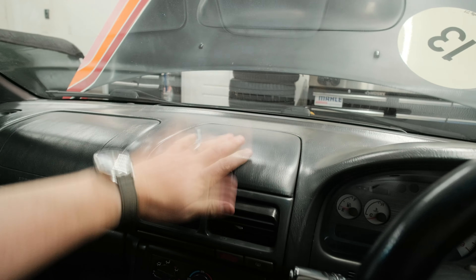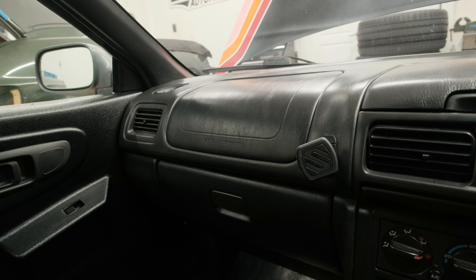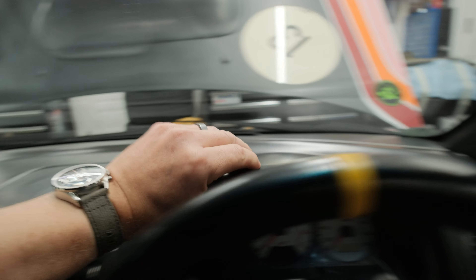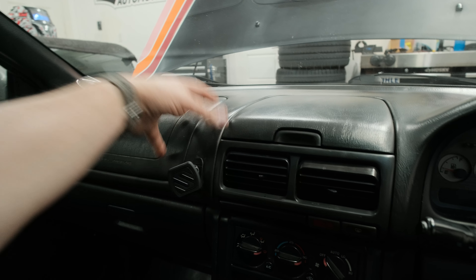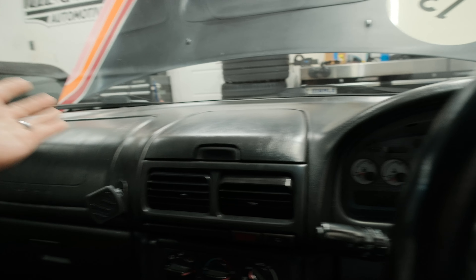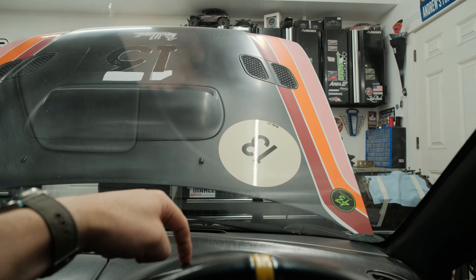One thing that I bought for the original build of the car to go on the first Overcrest Rally in Oregon was a dash flocking kit. I wanted to flock the dash because, as you can probably already see, this thing glares like crazy — it's that shiny vinyl material. What you do with a dash flocking kit is you sand it all, rough it up. It's got a primer on it that goes on, it adheres to it, and then you sprinkle — it's almost like a felt material — and it cuts glare on the dash. If you look at old Group A rally cars, race cars of all kinds, they all do it because when this thing gets in the sun, this section of the dash literally blinds me in the window. You can see right there — that's where all the glare goes.